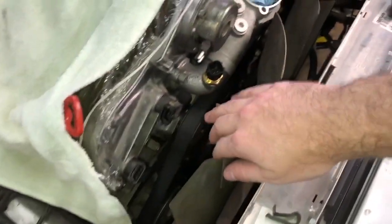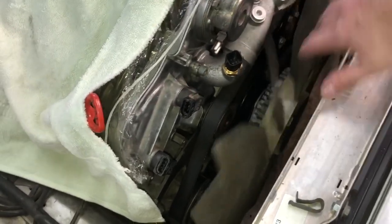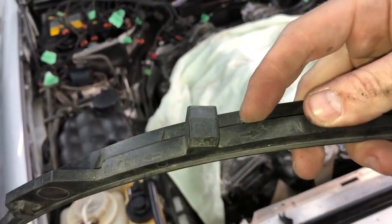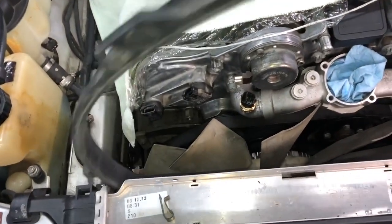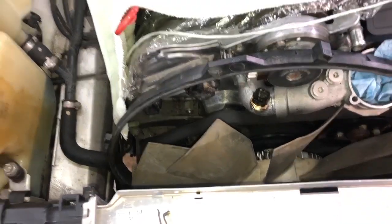Okay, now that you have your fan on there and that's a nice fan clutch, it's not free spinning, we need to grab the fan shroud ring first, because you can't fit this on if you try and go second. So the way this goes is, well, you're the mechanic, so you've got top, open, close, but just have the writing face you. Slide that down there, and then just set it on the front of the engine there. So we'll come back for that.